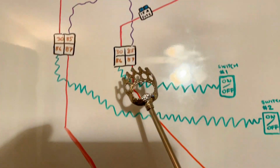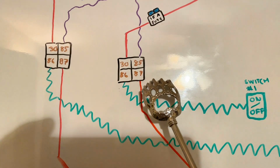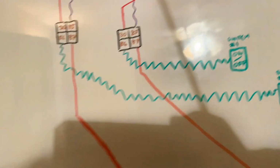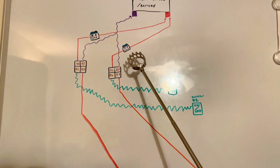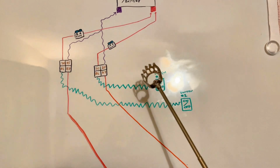It's gonna run up, because we're running it through a relay, it's a 4-pin relay we got off Amazon. God willing, I can leave the link in the description for that. So it's a 4-pin. So we're gonna run it to the 87. So just put a little inline fuse, 15 amps, 10 to 15 amps is fine.